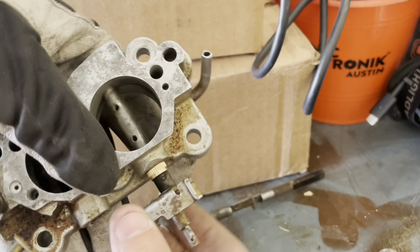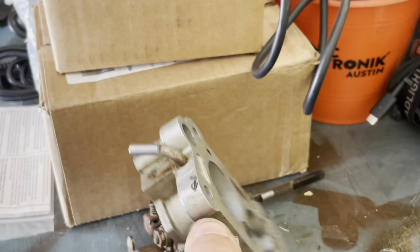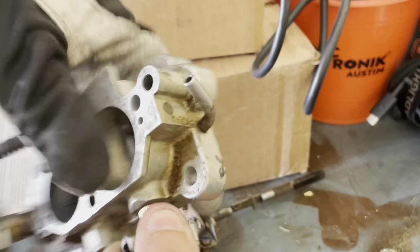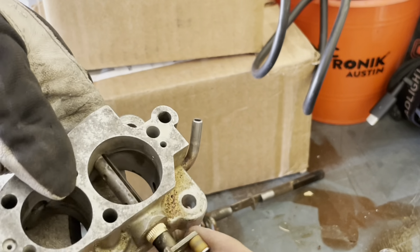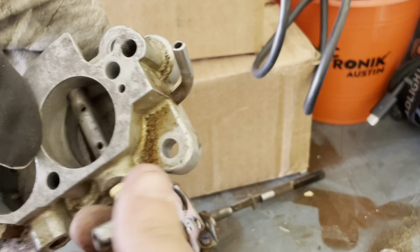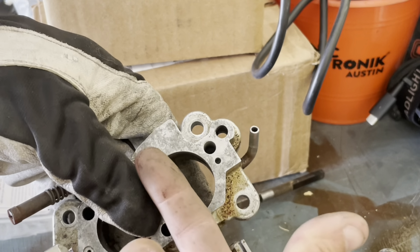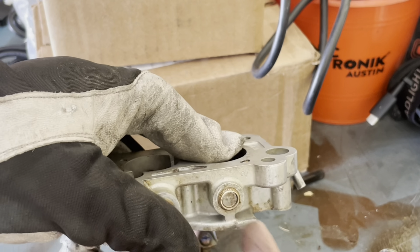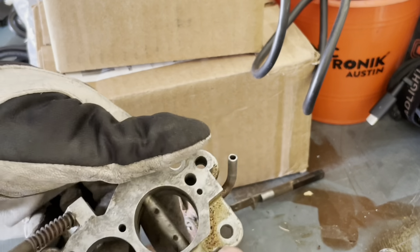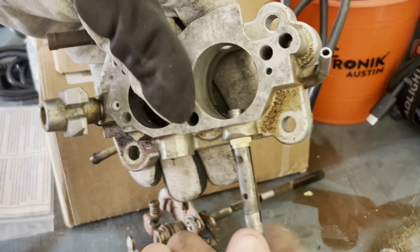So here it's way too tight. Like, I could hold the entire thing. It's supposed to be free rotating, but it's really tight. To fix that, you can get the reamer and just run it in. It could also be that the lip is bent in and causing friction on either side. So go ahead and get the reamer in. Try to loosen that up a bit.